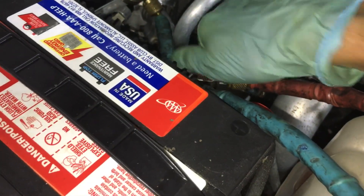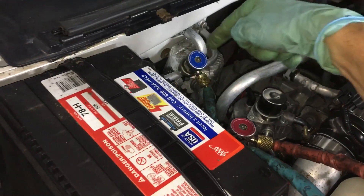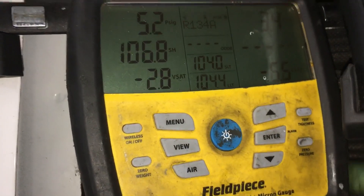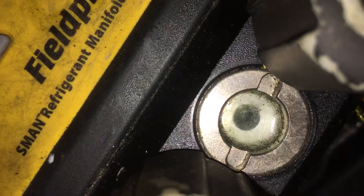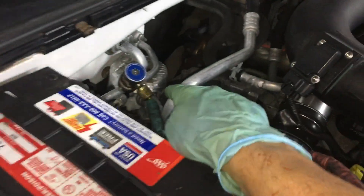Now I'm going to crank down the high side because the high side should be low. There's no liquid over there on the high side now because it's on an orifice tube right here between these two points. You see they're almost equal — 4.3, 3.9. Now I'm going to open up this one and watch the pressure. I opened it up — a little purge, a little change. Nothing happening in the sight glass.